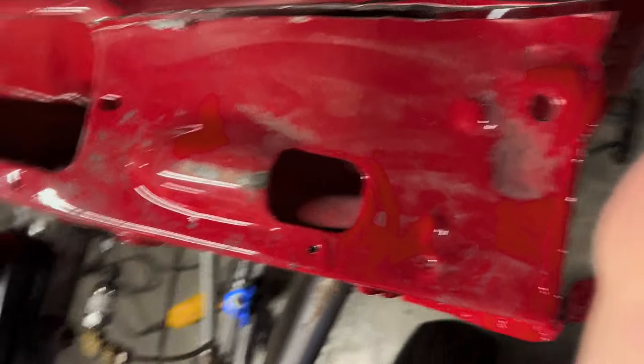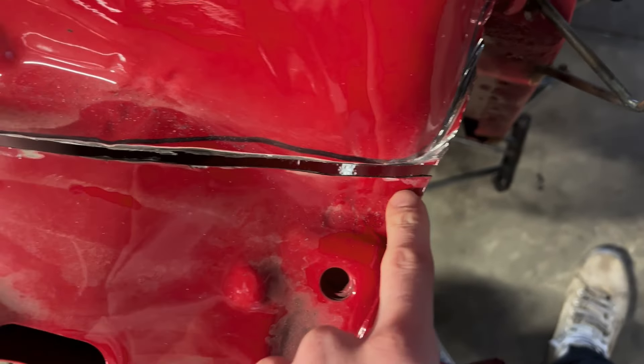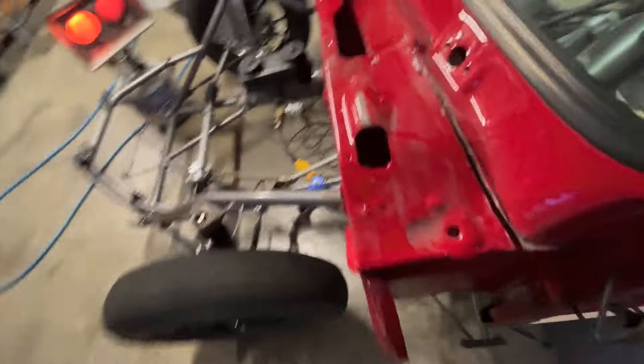We're cutting up that firewall. Not exactly cutting on the lines that I drew, because I can take a grinder and clean everything up and shape it the way I want it. I started out with some air, but that big tank couldn't keep up, so I went to electric and we're rocking now. I tried a couple things — cut on some body panels we had outside, some junk out there.